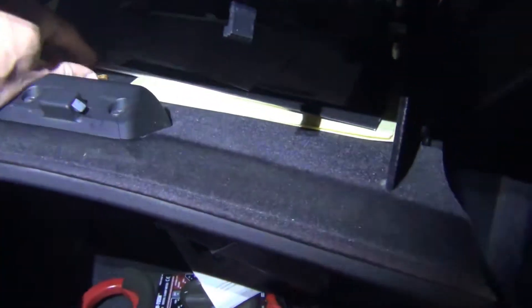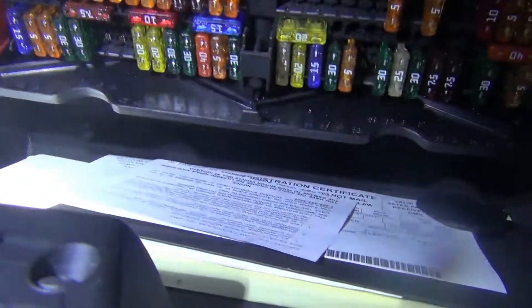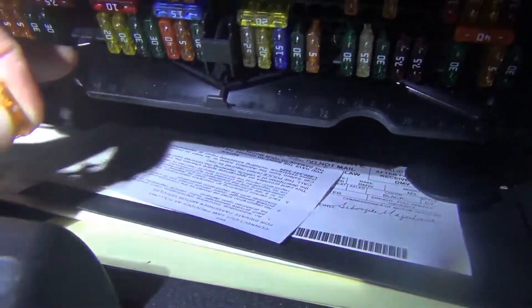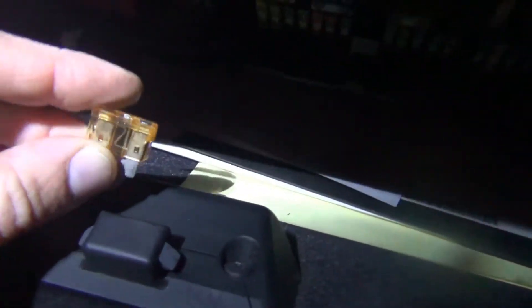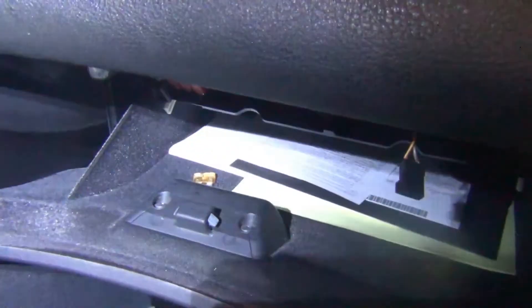This is a really helpful test if you're having a battery drain — you put a new battery in and your battery is dead again. On this particular car I removed fuse 43 right here, which is this 5-amp fuse that feeds the instrument cluster. So there's my culprit. But what I found was if I take that fuse out, everything in the instrument cluster still works — so that's confusing. Shouldn't my instrument cluster be dead?